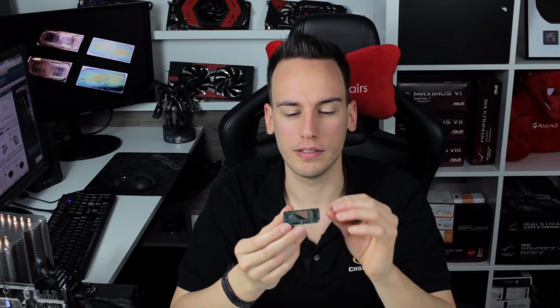I cleaned the CPU completely from the liquid metal residues using acetone, which works really well for getting rid of liquid metal — try that next time. I decided to leave the rest of the glue on the CPU since it shouldn't be an issue as long as it isn't higher than the core itself. I'll now go outside to my balcony to put the CPU upside down on the heating plate, because last time I did it indoors the smell was really bad and the gases coming off the PCB at 400-plus degrees Celsius are not healthy to inhale.